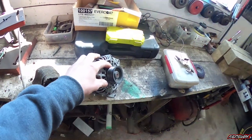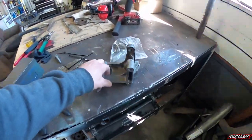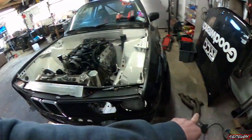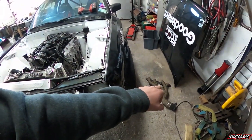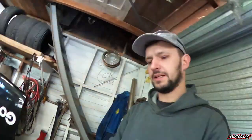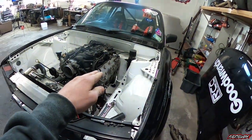Okay guys, now it's the next day. We gave these a quick water blast yesterday afternoon and it came up sweet. I just need to grind that broken bit off that bracket and that's pretty much good to test. Obviously because of lockdown I can't take it anywhere to get it checked, so I might do a bit of googling and see if there's a way I can test it at home on the bench - put a drill on it, spin it, and see what it's actually reading. Anyway, I figured may as well try and lift this motor a bit and get that header back in, because it just slipped up before. I think the thickness of the heat wrap is what's stopping it from going back in. So hopefully there's enough play in the tunnel - just loosen this engine mount, lift it up just a few millimeters, and then slide it in there, fingers crossed.